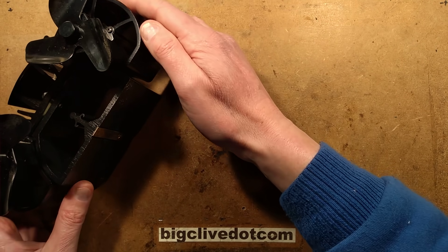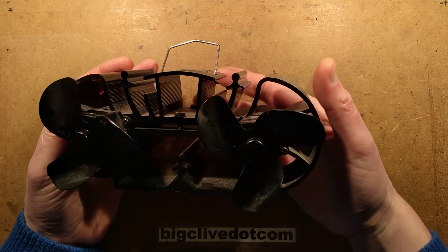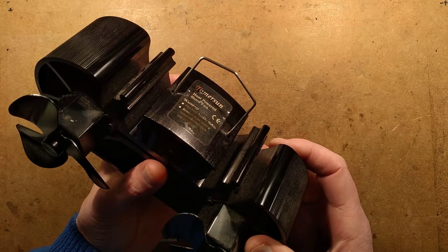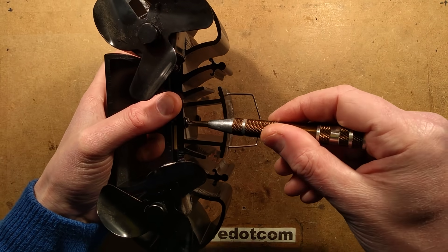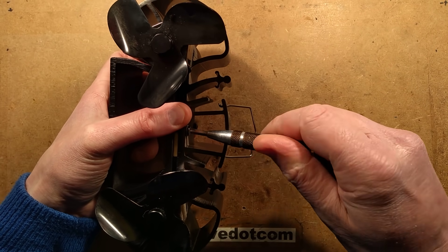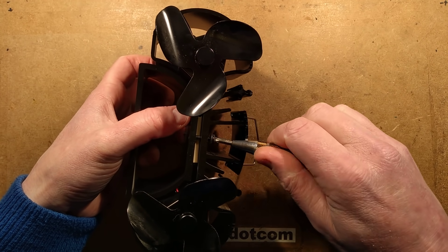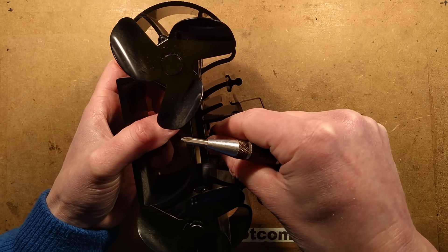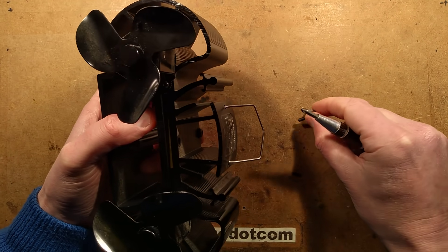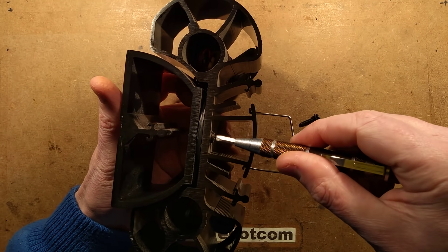The most common fault appears to be that the wiring is melting. Let's investigate that — let's take this to bits and see. Another common fault is that sometimes if the stove heats up very slowly it doesn't really get a proper differential between the two sections, and particularly with a low profile unit like this one it means the whole thing could heat up to the point where it actually damages the Peltier junction plate.